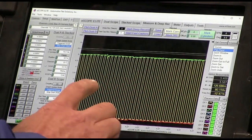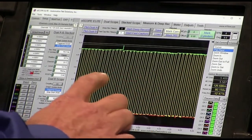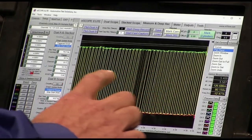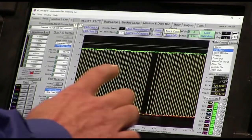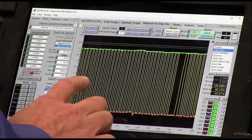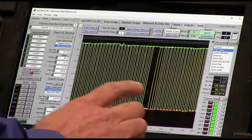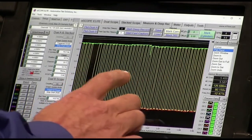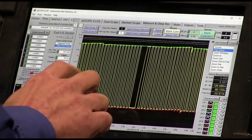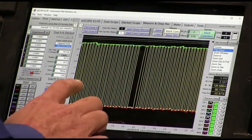These seem wide. I don't think they should be that wide after the hit there. But I don't think that's what's causing it. Again, you can see these ignitions all over these signals. Those ignitions don't seem to be big enough to probably count, because I'm thinking they're going to count about 2 to 3 volts on the edges. I don't see anything yet that's that low in here, but I do see the ignition having a problem.